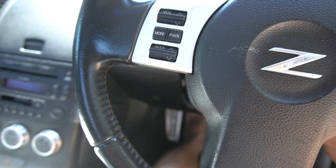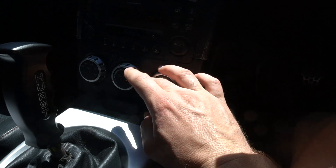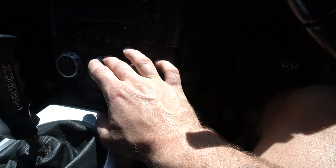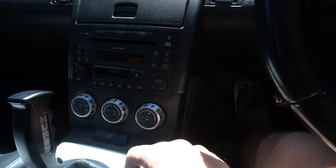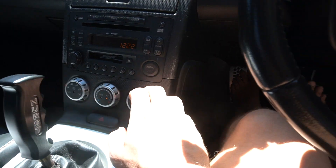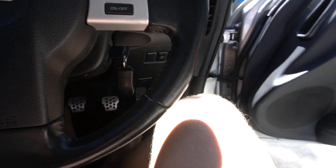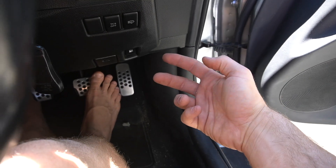I'll show you guys. So even with this on, I can hear the air con clicking but it's not blowing. So I think that is the blower motor. And apparently there's a blower relay which is actually behind the fuse panel where the normal fuses go. There's also something behind here, but the clutch is engaging — it's just not blowing. So one of those two, but it's going to be a bit of a mission. There's not much space there. Let's see.